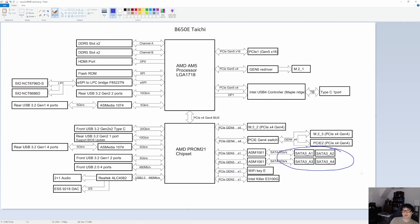It is nice that you can get four SATA drives off a B650 motherboard. The nice thing about the Taichi on B650E is that yes, there are drawbacks — no RAID on SATA, and you have to pick between the x4 slot or the third NVMe drive — but it gives you choice based on your use case. Overall, I'm quite impressed with the Taichi. It includes the Intel controller for Thunderbolt built-in, so you don't have to add a Thunderbolt card.